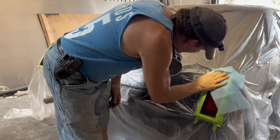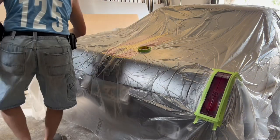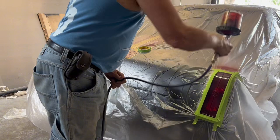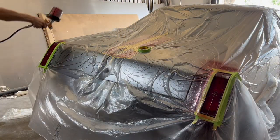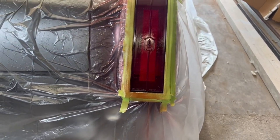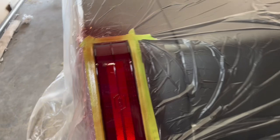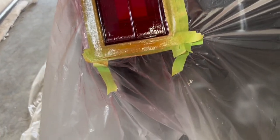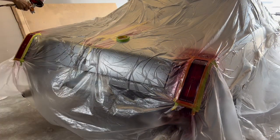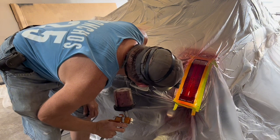Now I'm ready to give it a good tacking to make sure any dust on the surface is off. Then I'll spray my anti-fisheye coat — one real fast blast to make sure the film on the surface is clear with no gaps. If you put the first coat on wet and there's something that causes fisheye, it will, but when you put that coat on thin it's not thick enough for a fisheye to form. I'd call the next coat medium-wet.